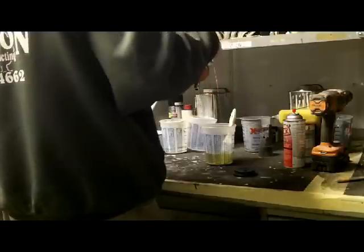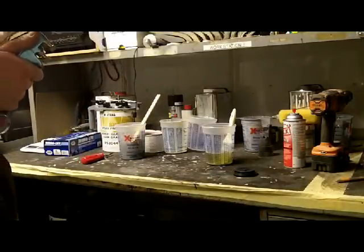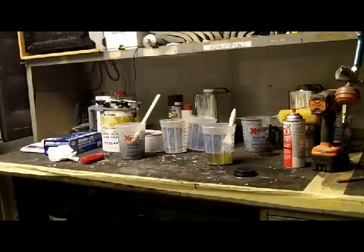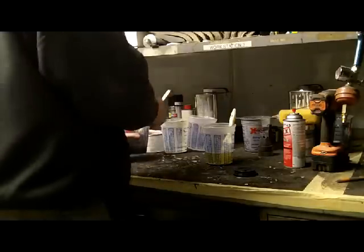Alrighty. Double checking it before I go and get ready to spray. Make sure everything's what it's supposed to be. Okay. Get a strainer, get a mask. If you guys have ever used these little touch-up guns, with those strainers, you can't just set it in the gun or it will run all down the side of it. So you kind of got to hold it up